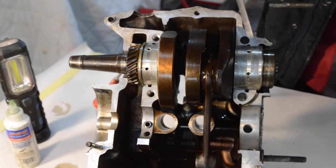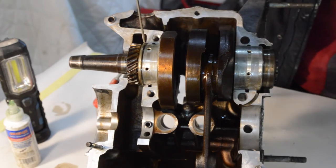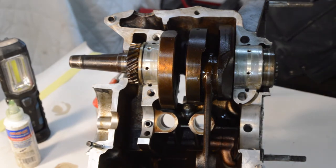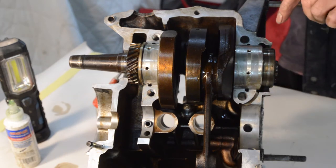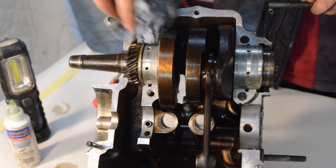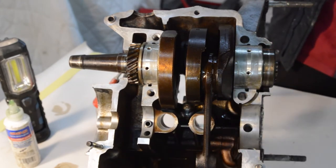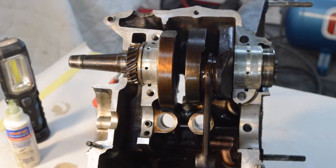The reason I knew it hadn't was because I'm using the original crank. You can see the witness marks through the centre which line up with the slots, and it wasn't quite in. You can tell by looking through the gap - if you haven't got it in right there's a gap. It needed rotating very slightly in order to line up the dowel, and then down it went. There are also lines scribed into the shells which have to match the case housing. Unless it is fully home the case is not going to go back together. Everything's lined up, lines are in place, everything matches the witness marks, so we can move on.